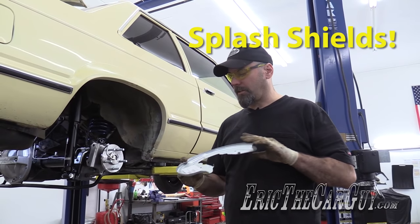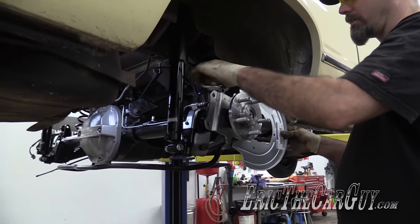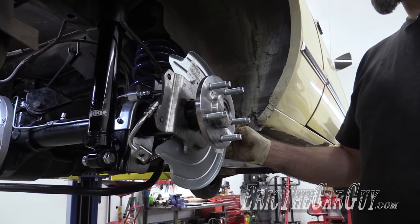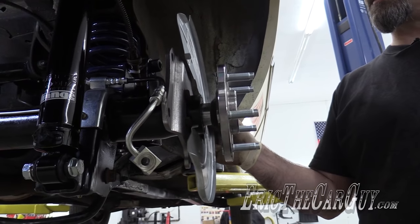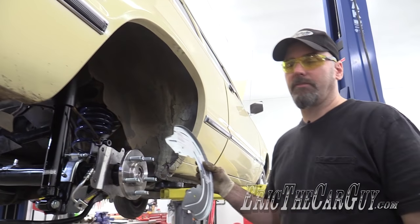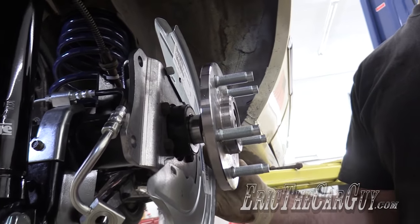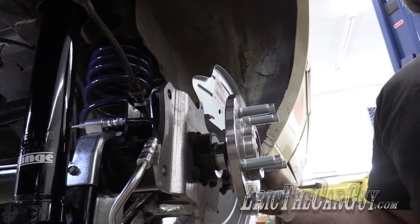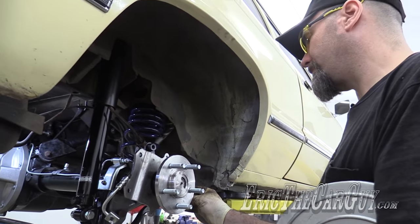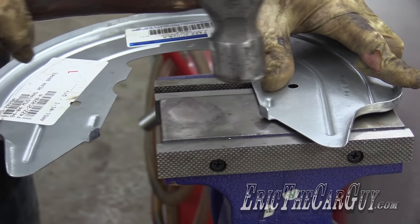I've purchased backing plates - I'll list the part number in the description. From what I'm seeing, this backing plate will go in here like this. I'm wondering if it has to go behind; if so, I'm going to have to clip these tabs, but if it goes on this side, we're good. I've played around with fitting these - they're for a 94-04 Mustang. I like them on the inside better; they're closer to the rotor on the inside as opposed to the outside. The only thing I keep coming back to that I don't like are these tabs. I had to come up with my own fasteners - I think they're six by one. On the 94-04 Mustang this tab has some significance, but it doesn't here.